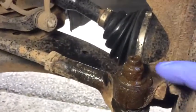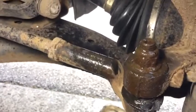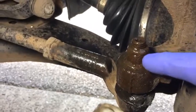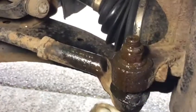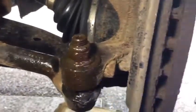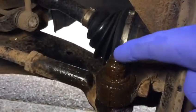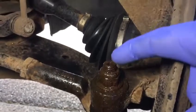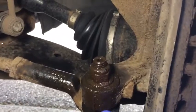As soon as we remove these nuts, because we don't have an air gun, remove that one easy peasy. Just use the ratchet, pull it down. When you get rid of the nut, we can just tap with the hammer here to loosen the ball joint, to drop the ball joint. Just hammer it here. Make sure you don't hammer the back plate or the disc. As we don't need the ball joints, you can hammer the top of this one too. But make sure you don't make this one a mushroom, otherwise you're going to get stuck here. So if you hammer around here and you hammer on the top, we're going to remove it,